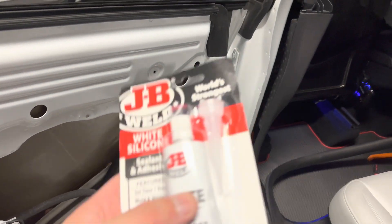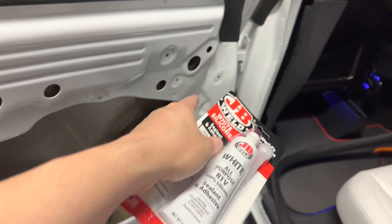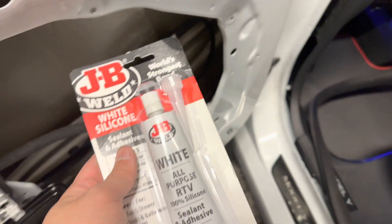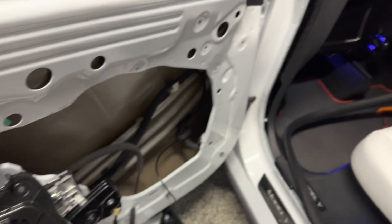And I'm going to go ahead and fill those gaps up. At least you don't have to do it for the whole entire door. Don't block out the bottom — it's supposed to have holes down there so it drains. But the right door doesn't have this, so we're going to seal this up using this. I'll post a link where you can find this too.